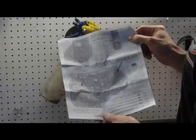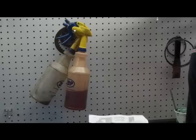Or they'll call up and, based on these instructions, it tells you that based on what size band you have is how you have to drill this hole. Now almost everybody here is using what's going to be the wide band, which is your turbo transmission. So the final hole is going to get drilled to a number 35 drill bit, which is 110 thousandths.